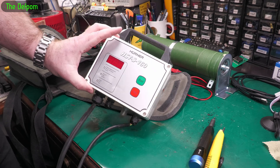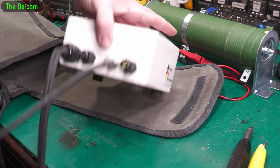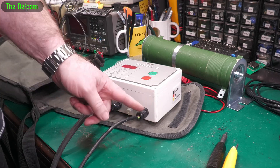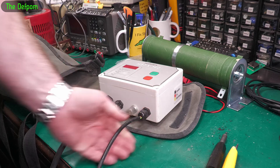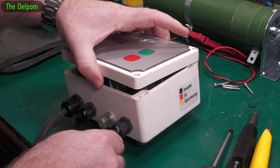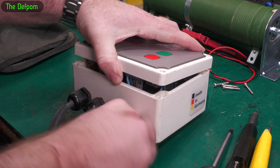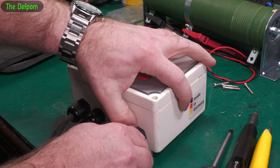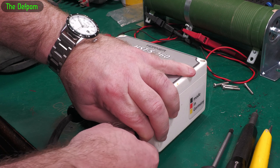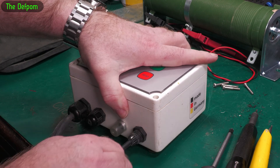I've got another one - this one needs a bit of a check over. The cord's pulled out so I'm going to open it up and check the inside, make sure the wiring is okay. The fact that they were using it like that's not great, considering it's really easy to fix - you just loosen the gland off and shove it back in. The gland is spinning anyway. It was a little bit tight when I went to move it, then it moved. If someone was taking care, they could have done it.